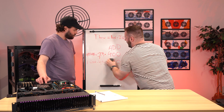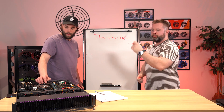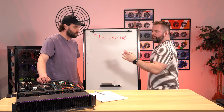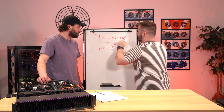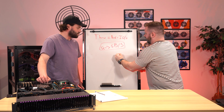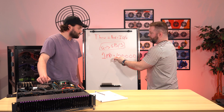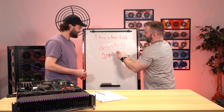This is why NVMe is so powerful. An NVMe's limitation is at the PCIe lane — we're using two PCIe lanes per NVMe. The standard is four, but we do two because we're super dense with 32 NVMes in a system, and that still gives us tons of performance. We have about two to three gigabytes per second of bandwidth per NVMe back to the CPU. Now an NVMe may be capable of something like 1 million IOPS — it can go until it saturates that bandwidth limit.